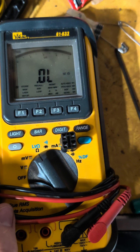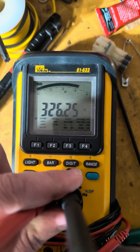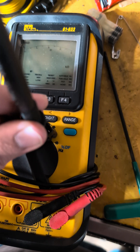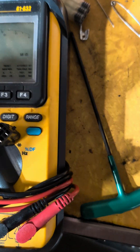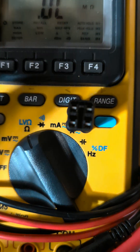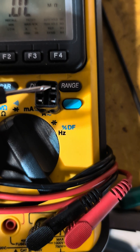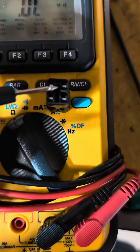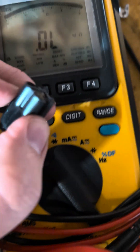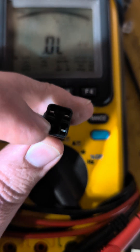I'm going to probe it and see what I get. Measuring across the two bottom terminals, I get 326 to 328 ohms. There was nothing else across the rest of them — nothing up and down, nothing side to side on the top, and nothing catty-corner. So all this connector is is a 328 ohm resistor sunk in there with the bottom pins attached to it and some sealant on top.